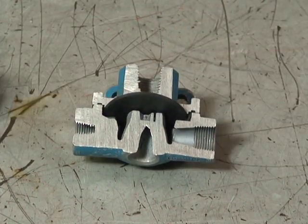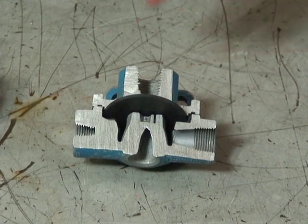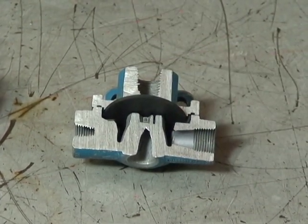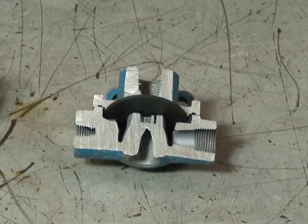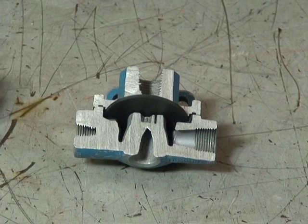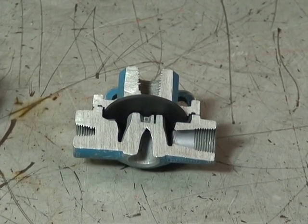So it pushes up this way and it opens the exhaust, and we quickly release the air out of that circuit. So we can sum up by saying the quick-release valve is designed to quickly release air from circuits, as well as act as a T in the circuit. A very simple valve used in a number of areas on the vehicle.